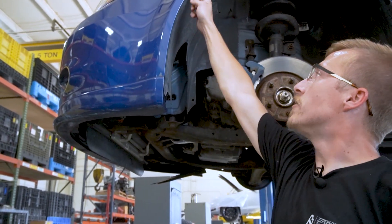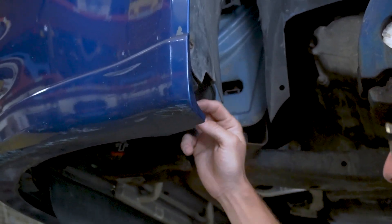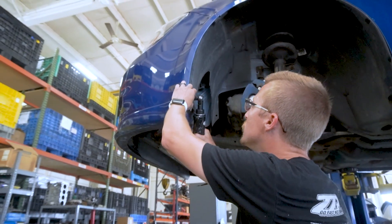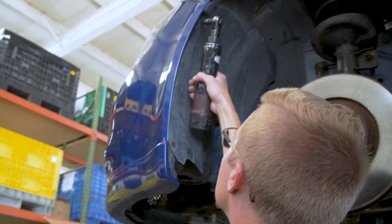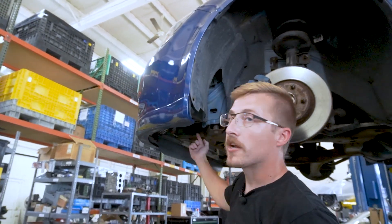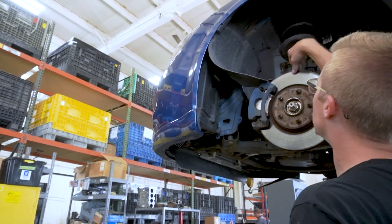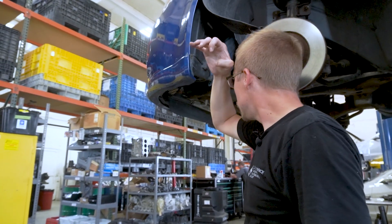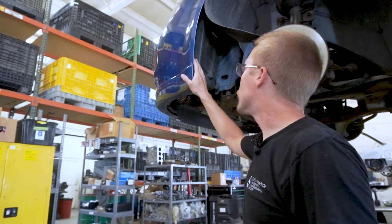To get in here, there are three 7mm screws here, and you'll likely have a 7mm back here as well. Then you're going to have a couple 7mms underneath where it supports on the bumper. Just whip those ones out. You're going to have to remove them down here and then a couple here as well. Pull that fender liner back — they're flexible, so you can pull it all the way back and zip tie it up out of your way so you can access the stock airbox. It is a fairly large unit, so it does have to come out the bottom.